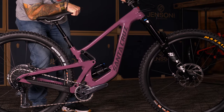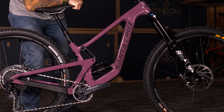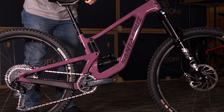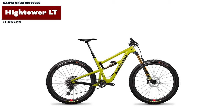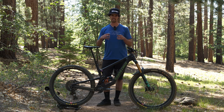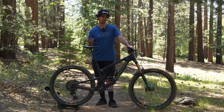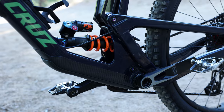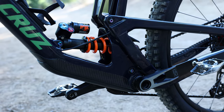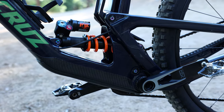Santa Cruz has been using VPP for a super long time, upwards of at least 10 years. More recently they switched all their bikes to this lower shock mount design. The previous design had the shock higher up, and that created a kind of bell curve in the suspension where the platform acted digressive at first, then became linear, and then progressive at the end — which is just a hard style of suspension to tune shocks for. So they redesigned it with this lower shock mount, and now all the bikes have a really nice smooth progressive curve which makes them ride very predictably but incredibly well.